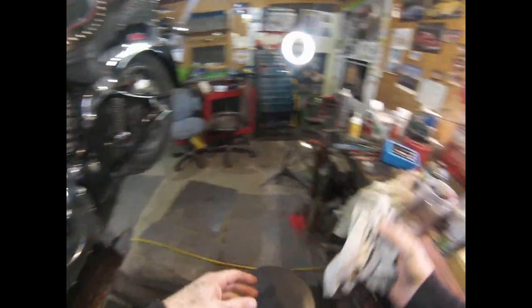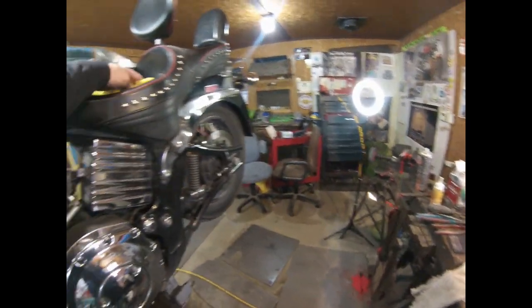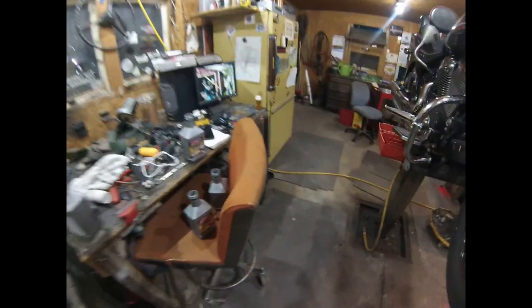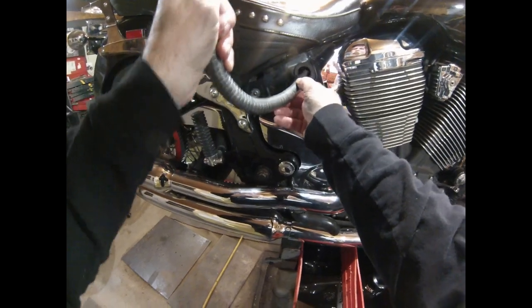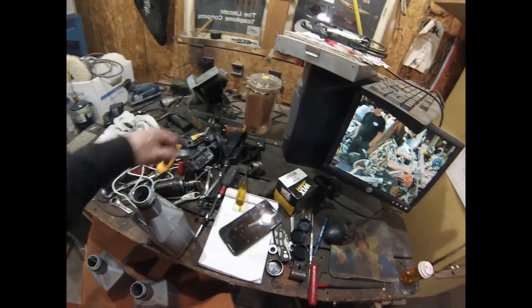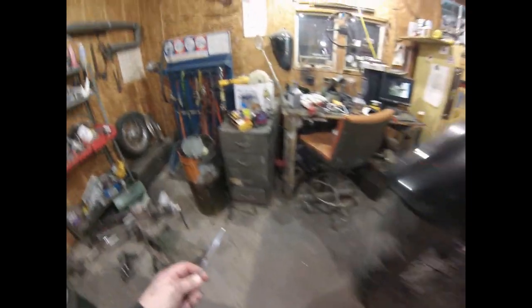Got my seat oiled up — the oil won't hurt the leather but it may create a problem with the stitching. You've probably noticed I don't get the bike strapped down on this rack or lift — it works really good as long as I'm not wrenching hard on it; it'll sit there all day and won't move. If I'm going to be pulling hard on it, pulling tires off or something from the front end, I'll strap her down. Being this is just a simple oil change, not that big a deal. You're changing your oil and you want to get it full — three quarts four ounces is a nice place to start.